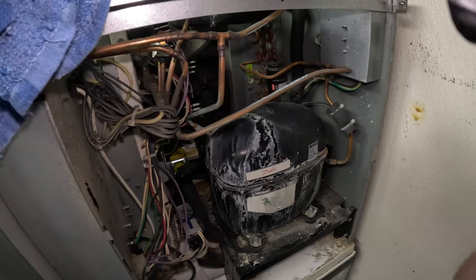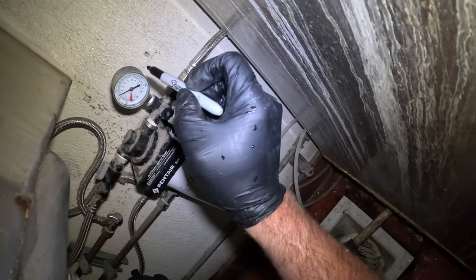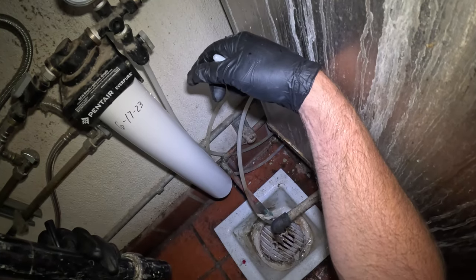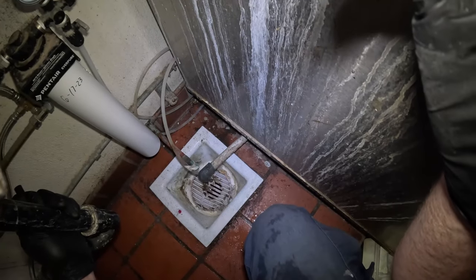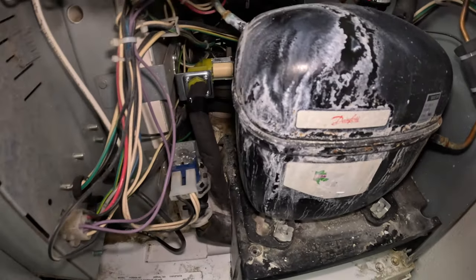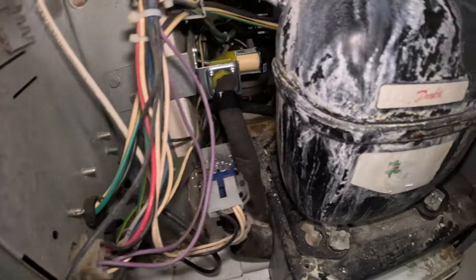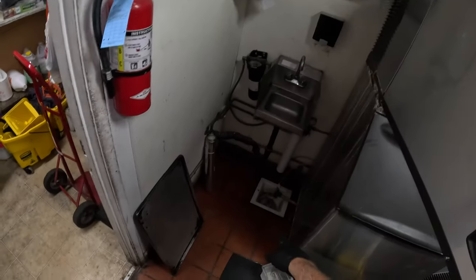NorCal's tip of the day: we got the new water filter in. Check the water pressure - it's about 48 PSI, so that's not enough to blow that valve up. Get your new valve in, charge it up. Run a bunch of water through here to get it charged up - that'll charge up your filter. I already had it pre-charging but I wanted to show you that. I want to make sure I don't have any leaks, so I'm going to double check this thing. Start cleaning this ice maker. So far so good. Wash cycle - we're purging. You can see how good my flow is on the dump valve.